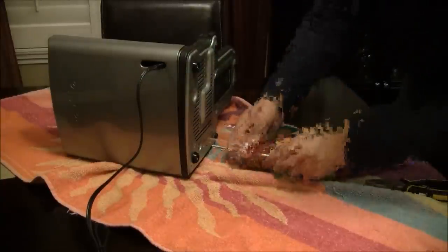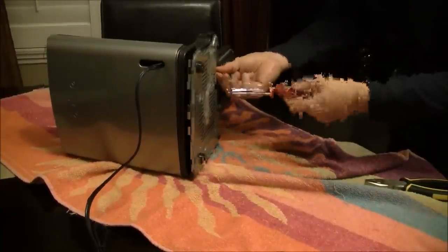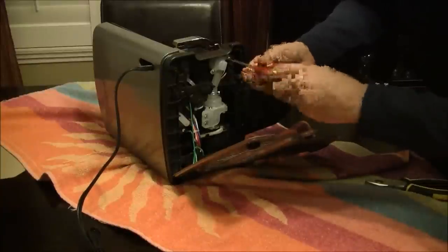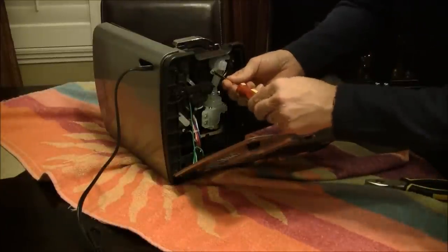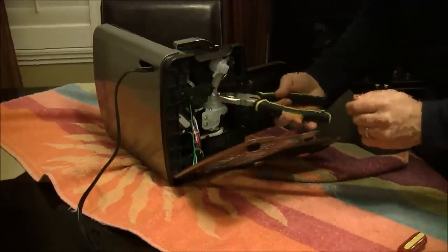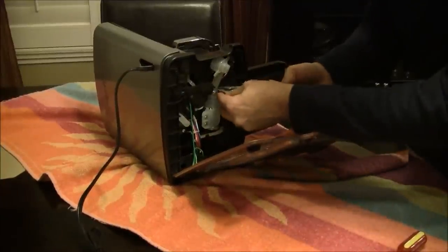Here's how I did a good proper fix on this machine. You have to turn it over, put it on a towel in case any water spills out. Take out about eight or ten screws that were on the bottom of this machine — you'll notice I've already taken most of them out in this video. And once you take the bottom of the machine off, you can now see the water pump and the water pump inlet. I'm going to use a Phillips screwdriver and just take out the two screws that hold the water pump inlet. There's just a couple, not too hard to get out. I also opted to use a pair of pliers to take off the hose that goes onto the pump. It just makes it a little bit easier to get the filter out when you remove this whole unit from the machine.